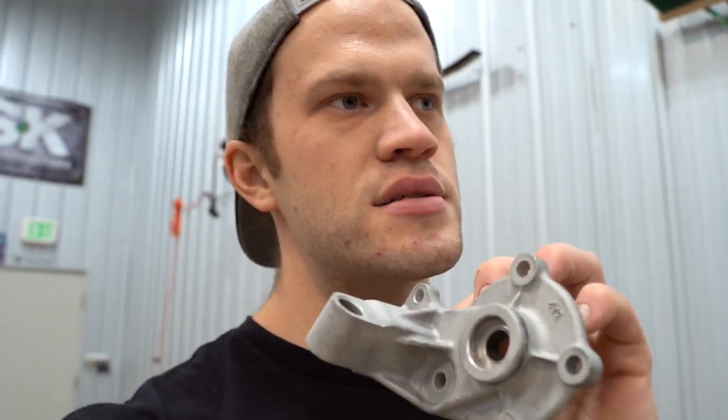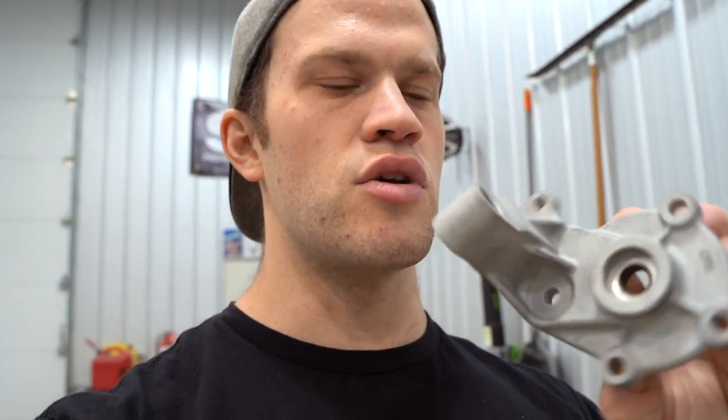And then we're gonna sandblast it. And then after that, you put it in the oven for 60 minutes, outgas the part, pull it out, let it cool down, spray it, throw it back in for another 60 minutes, and then it's cured. So that's the process. We could definitely soak this in acetone, but I wanna make sure this process is gonna work. So I'm gonna do this with the brake cleaner method, and then we can move on from there.